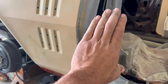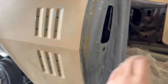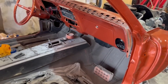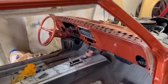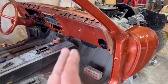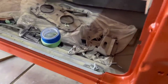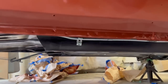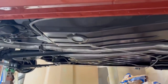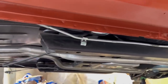The plan is to paint this quarter panel without any tape lines. When I get the doors back on, I'll have the door open, paint the door jamb, just rest the door shut, and then paint the entire side of the car. Look at that dash — just looks fantastic inside here. I'm loving the idea of the autumn bronze dash. It's going to be a really unique car — subtle touches of custom, not over the top, but definitely not how it came from the factory. And painting that rocker panel all the way down to the bottom really gets an awesome effect. You can't imagine how many cars I look at where they miss that.